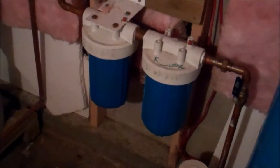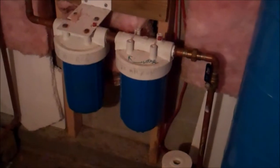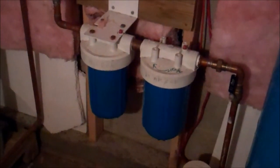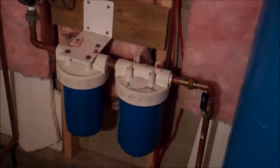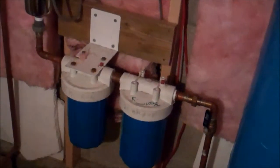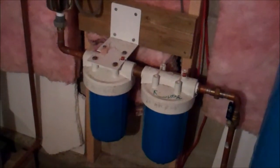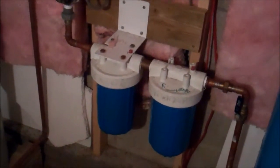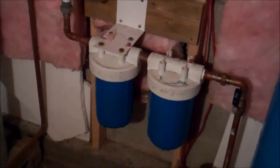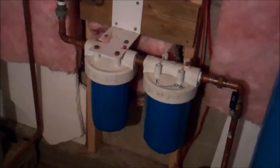Next, you want to detach the water housings. Dump the water out. You can use the water that you drain from the lines to clean the inside of the housings should there be debris there. Save the water filters. The water filters clog up mostly because of skeege that builds up on them when they're not being used. And if you soak them in a good strong Clorox solution, maybe a quart of Clorox and 5 gallons of water, that'll take that skeege off, so you can reuse your filters. If there's a lot of debris in the filters, well, a lot of sand from the bottom of the lake, that's a bad thing.